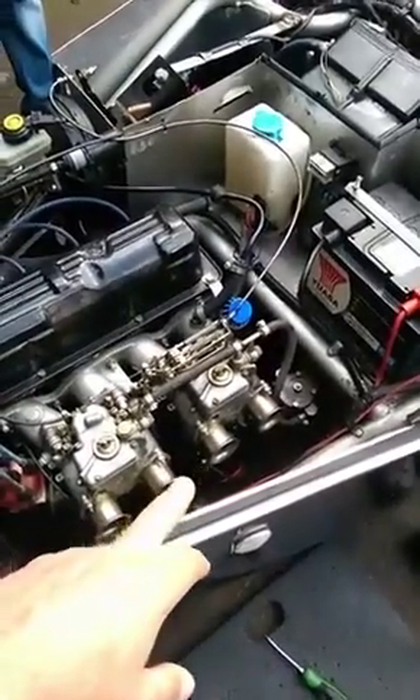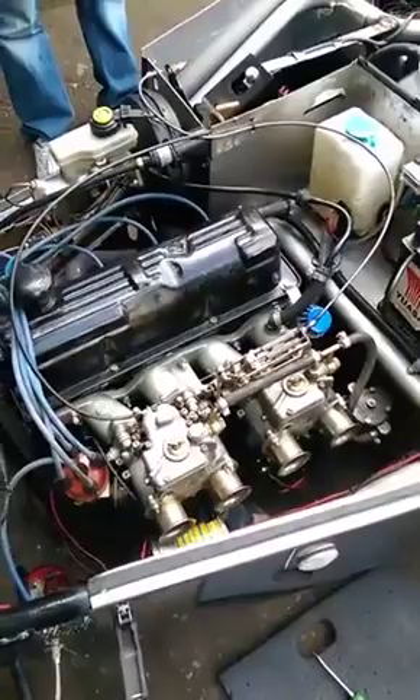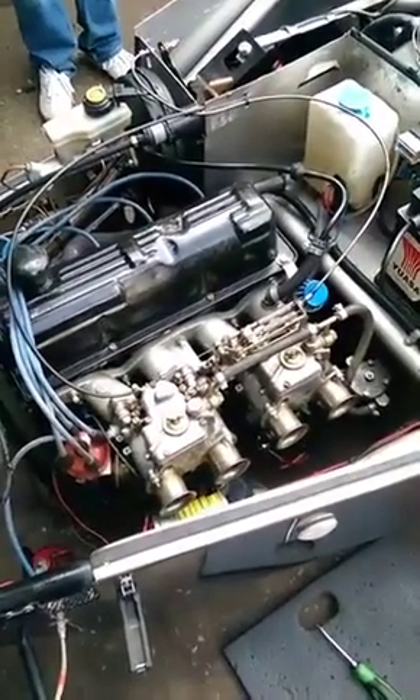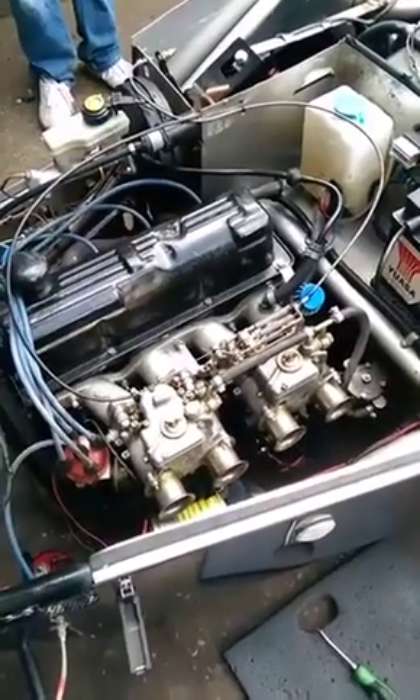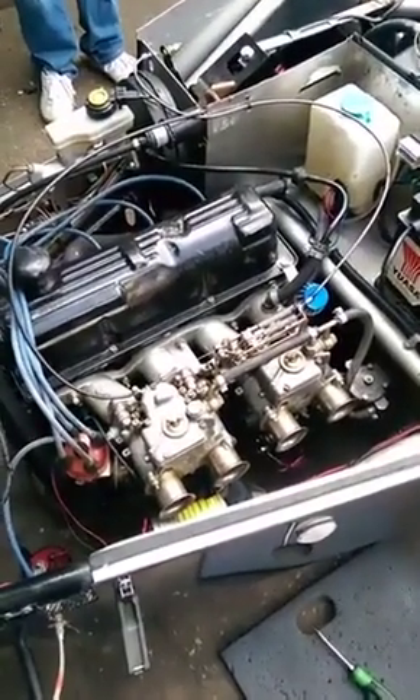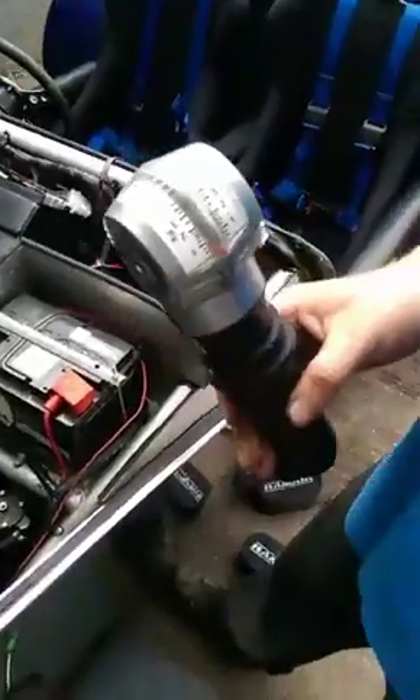You're going to try and tune this car now despite the fact that it's got a might-be bent spindle — trying to get it as best as you can. Check the spark plugs, because that is more of a low-down thing. At the top end on full throttle you can see the slight stutter on the engine. Once you get onto the main jets there'll be a slight air difference — as long as it's not a lot, because it's only slightly out, it shouldn't make too much difference. You can't tune carbs really without one of these. Thanks for watching — that was a scary moment. Nearly blew up a customer's car; thankfully it didn't. Send us your comments, likes and shares, and if you need a synchrometer airflow meter, give us a shout. Cheers, Chris.